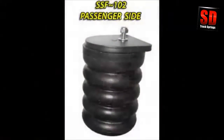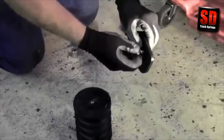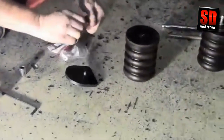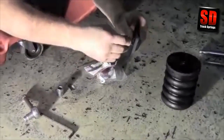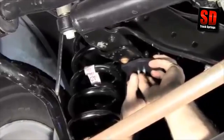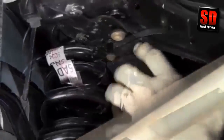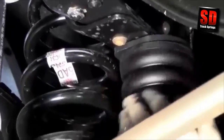The passenger side part has an offset adapter plate already screwed into the top of the sumo. Unscrew this plate, apply Loctite to the threaded stud, and attach the adapter plate through the threaded hole in the frame using the flathead countersunk screw. Install the washer and nut on top of the stud and tighten securely. Screw the SumoSpring back onto the adapter plate securely.